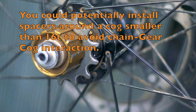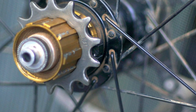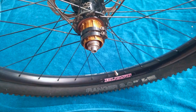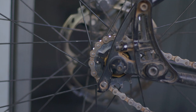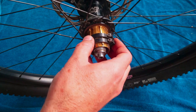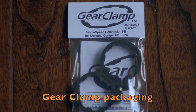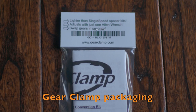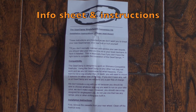So there are pros and cons, but overall for my single speed use, I prefer these night and day over the regular system, mostly because I can change cogs so quickly — especially if I have a chain dedicated to the cog and chainring combination I'm running. Then it's super easy at a race to just change them out. I don't have to mess with that lock ring, and I really don't like having to do that. It might seem simple to a lot of you, but it's just a pain. Whereas this is super easy. So that's my review of the gear clamps — I really like them and I'm going to use them every time I go single speed.